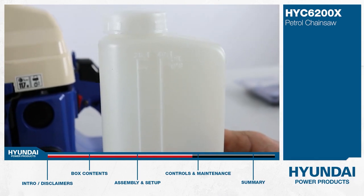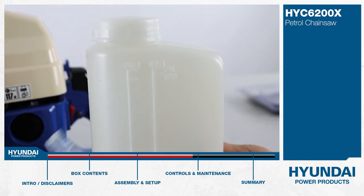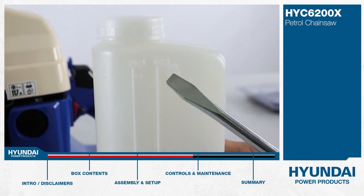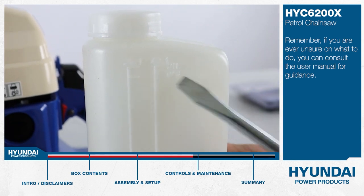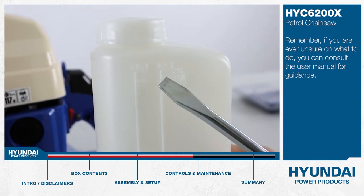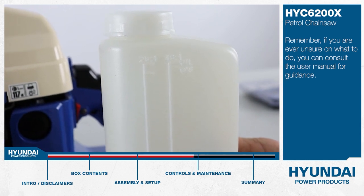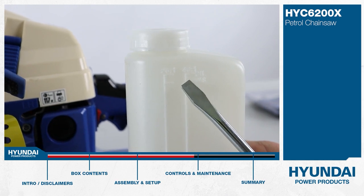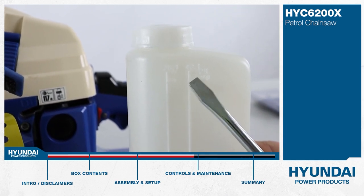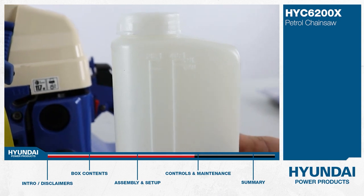Okay, so the bottle we supply does give you graduations. On the left here we have a ratio of 25:1, but on the right here you'll see these two lines. The bottom one says gas, okay, gasoline, petrol, fresh unleaded petrol. What we would do is put the bottle on a nice level surface and fill it up with fresh unleaded petrol up to this lower line. Okay, so be quite accurate with this and make sure the bottle's level, fill it up to this lower line.